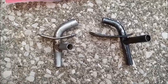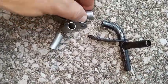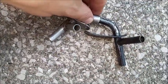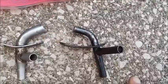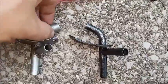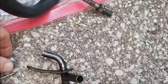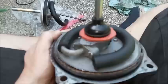Here's a comparison of the pipes. The internal pipe for Delco Moraine is bigger than the pipe for Bendix. On the outside, the pipes are the same, which is necessary since they hook up the same way. They also go in opposite directions inside.